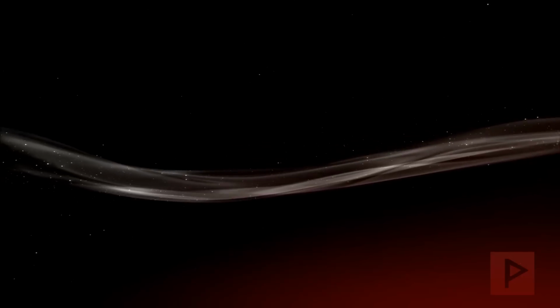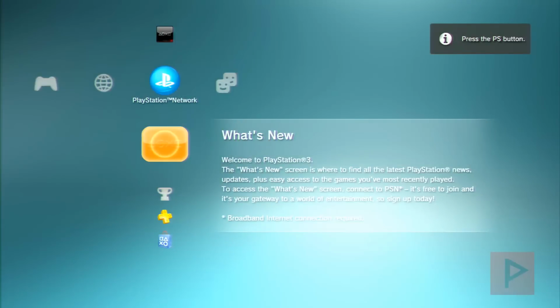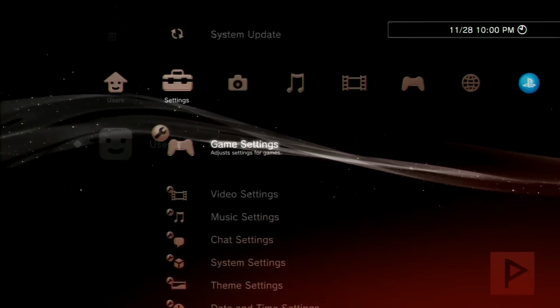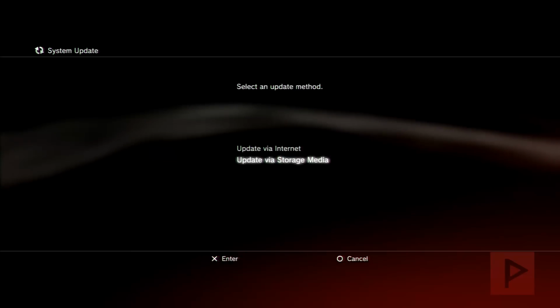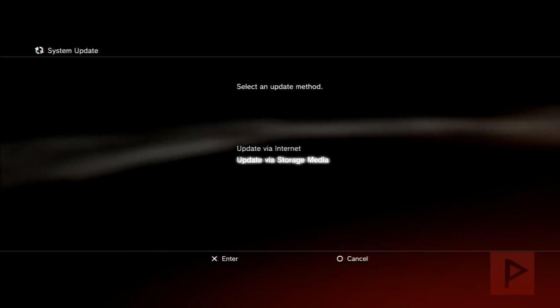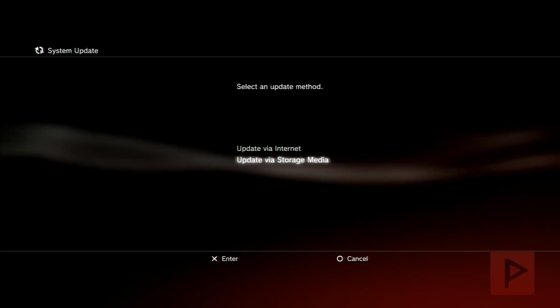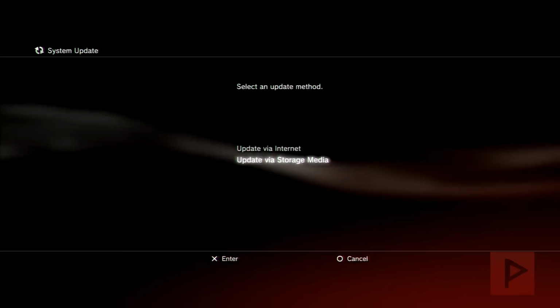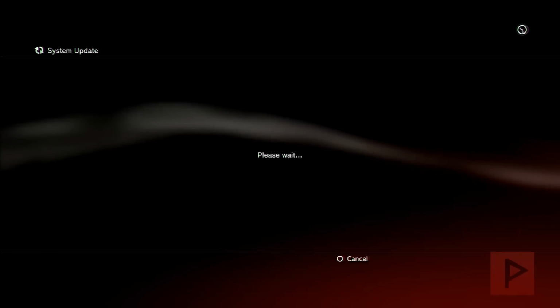Okay, so we're in the home stretch, guys. So we have successfully done the hardest part, which is just getting your PS3 to go through that website and get a fix, so to speak, from there. So now what you want to do is reconnect your controller, go to System Update, and if I didn't say this in the first portion of the video, I'll say it again, this whole process assumes that you had your USB thumb drive in the rightmost port on your PS3. So what you want to do now is say update via storage media, and it's going to find that Rebug firmware file that we had earlier, and just go ahead and follow through with the process.